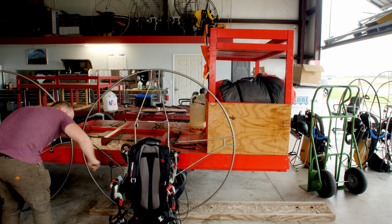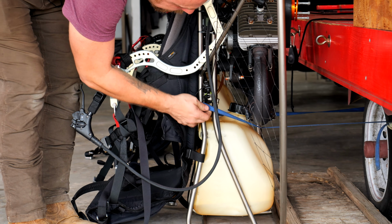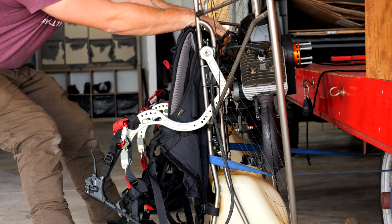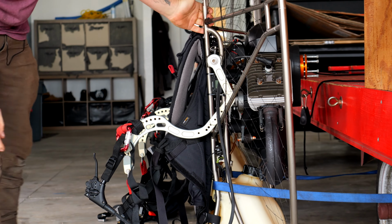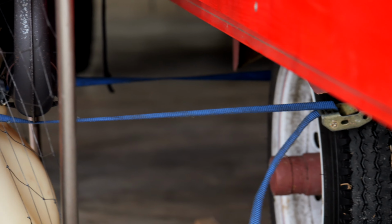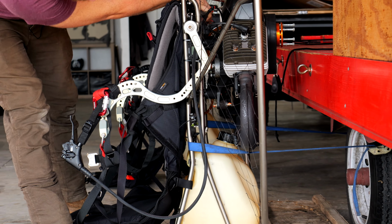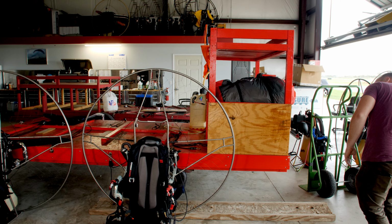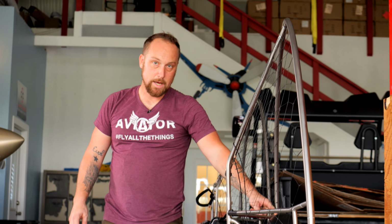So this other side looks decent here. This side here, not so much. So what I'm going to do is raise the strap up a little bit. Let's see if we can get our bend up a little bit higher. Tighten the strap up a little bit more. All you're doing is just working that titanium back into shape. There we go. The hoop's starting to look better. All the spars are starting to come back together, like this gap over here that we had earlier is coming in.